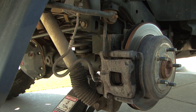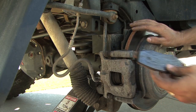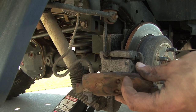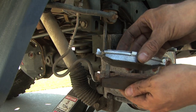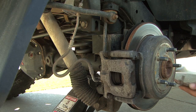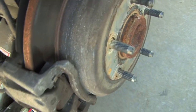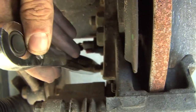This is what a brake pad looked like on the other side of the Jeep. These are stock brakes with about 46,000 miles on them — that's miles pulling a landscaping trailer and also an off-road trailer. And here's what a new pad looks like. These are Duralast Golds picked up at AutoZone. They're not supposedly the best out there, but they're better than stock.